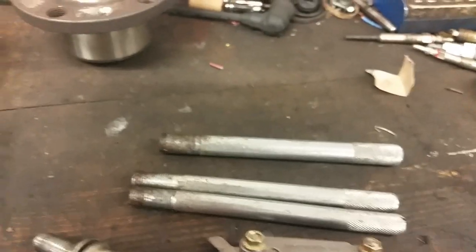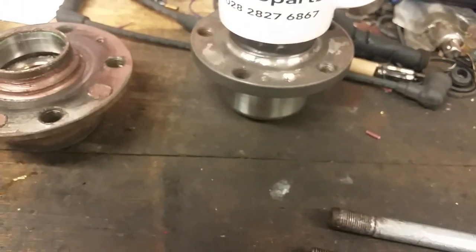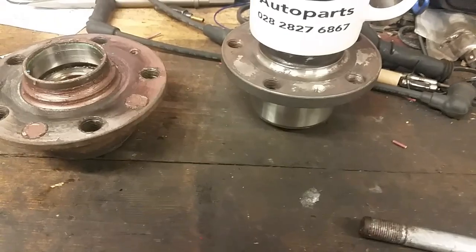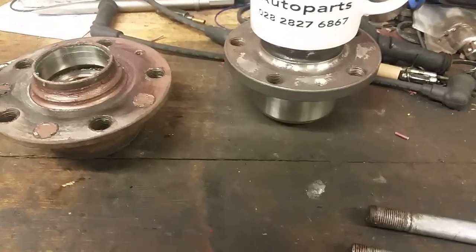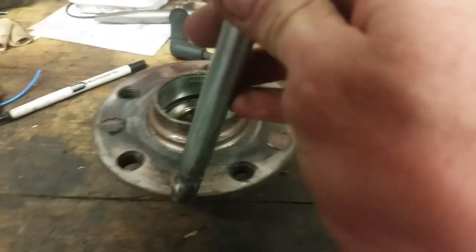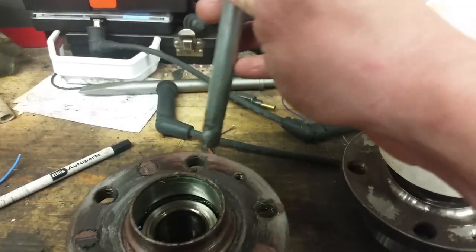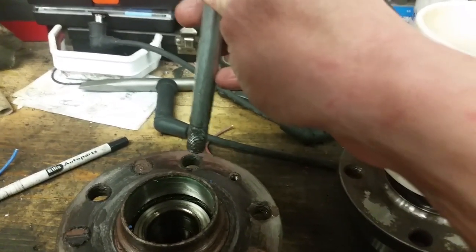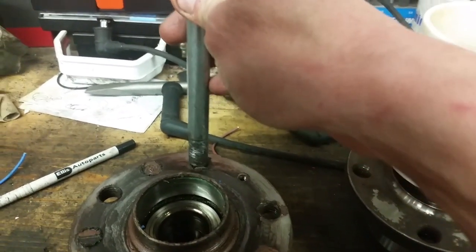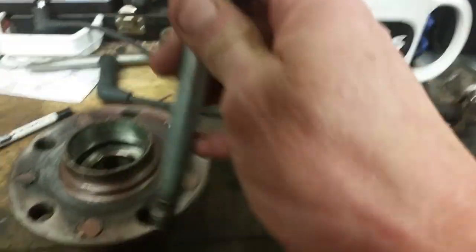So they're very, very useful. As I say, you can hang the wheels on, and you can walk away and leave the wheel hanging there. As long as the hub doesn't rotate, doesn't spin around, and the pin goes down to the bottom, as long as it's stiff enough. Usually whenever the brake pads are on the disc, it'll hold itself okay, and it doesn't just fly down.